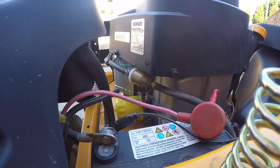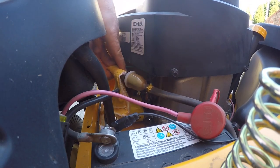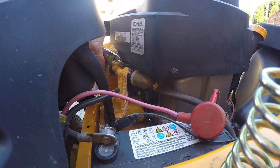We'll go through steps for how to get this done in the most efficient and clean way. I'm going to try to maintain visibility for you as much as possible, but I'm going to take a shop rag and wrap it around one end of the hose, and I'm going to use some vice grips to clamp down on the hose to cut off the flow of fuel.